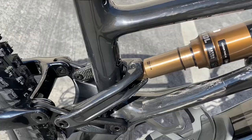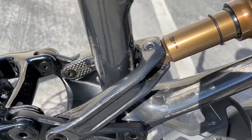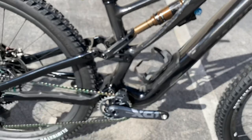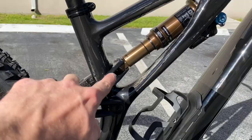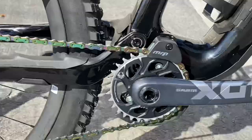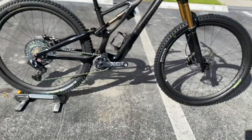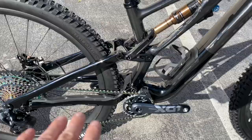This is a very cool piece — this is only for the S-Works models: a full carbon linkage for that link arm. You can see that carbon weave right there, it looks insane. Going to the back, you do still have a two-piece system for the linkage. The reason for that is you have this flip chip — they actually changed it. The flip chip used to be elsewhere on the old Stumpjumpers. On the Evo it is right here, and you can see it says high and low. Right now it's in the high position, so it is 10mm higher for the bottom bracket. If you put it in the lower position it'll be 10mm lower.